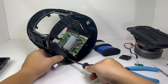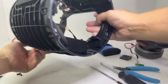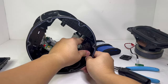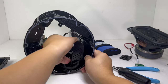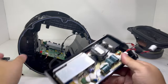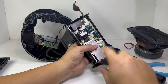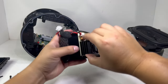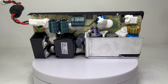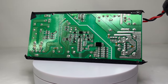To access the AC circuit board, we will need to remove three screws from each side of the cover. With the screws removed, the whole cover along with the board will come off together, requiring four additional screws to take off the AC board itself. This board supplies the speaker with 180 watts of power, enabling it to play louder compared to running off battery power at 136 watts.